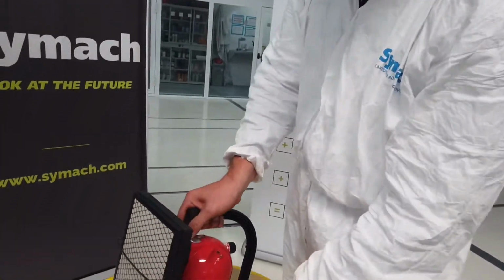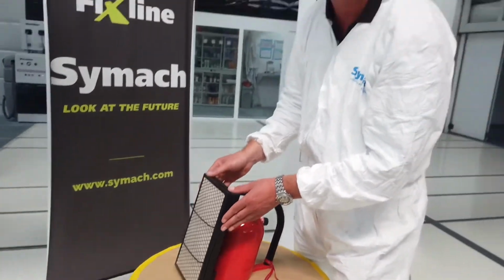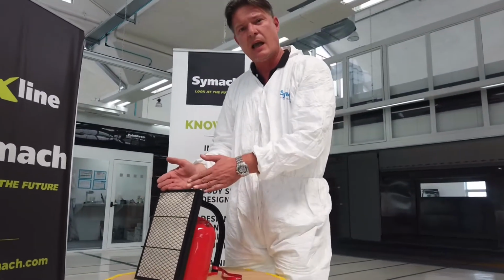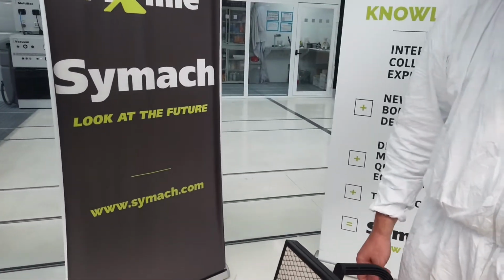What other features are there on this unit that you can tell us about that we need to know? The Drytron is very comfortable. With that lamp, we can dry every product from the filler, primer, base coat and clear coat in a few seconds. As you did yesterday, we can dry the filler in less than 1 minute, ready to sand. It works very quickly. It works very similar to the units that you've seen us use in the fixed station, the large gas infrared lamps, so it's on the same sort of principle. You've not actually got a flame coming out. You've got the panel heated up, and it's the heat that's the infrared curing system.